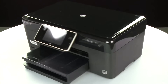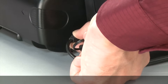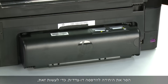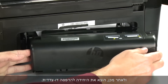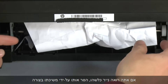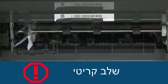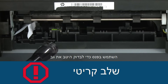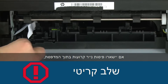Turn to the back of the printer. Remove the USB cable from the printer and unplug the power cord. Remove the duplexer by pushing the right side of the duplexer to the left and then pulling it out. Check the back of the printer for jammed paper. If you see any paper, remove it by pulling evenly with both hands to avoid tearing. Check the rollers and wheels for torn pieces of paper that might remain inside the printer. Use a flashlight to thoroughly search the back of the printer to find all small scraps of paper.